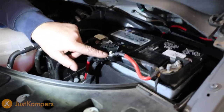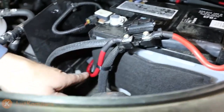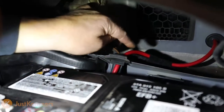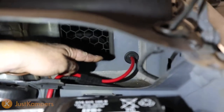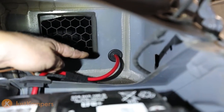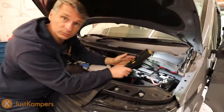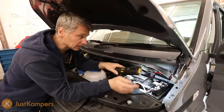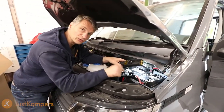The feed is running — I've still got my fuse out so it's not live. We've followed our original wiring around the back of the battery, gone through our original cable grommet, followed the loom along with a bit of cloth tape, and then through our wiring grommet at the back — the one we cut and fitted a grommet into — which takes us into the cab. That's a nice waterproof, good route from our battery to inside the vehicle. Next, I can put our tray back and that's the under-bonnet work finished.